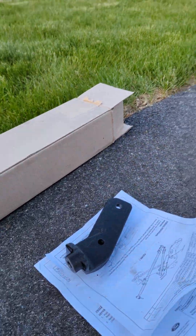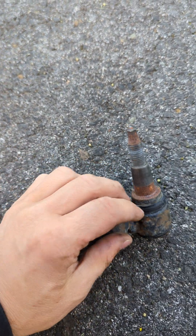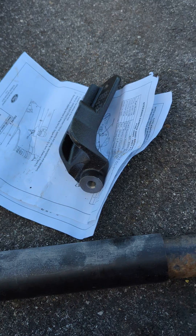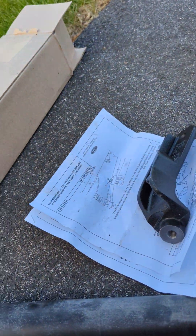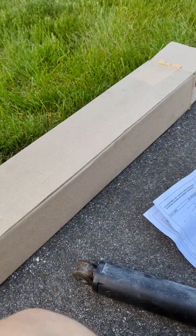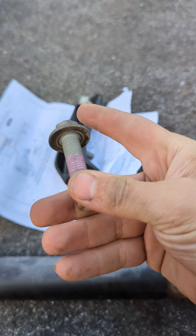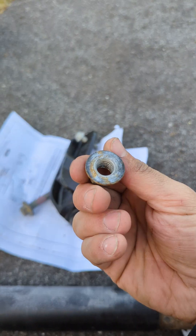It's easy, not hard. The hardest part was hammering it out. There's a fork you can rent that makes that easier. I didn't change the bracket — you don't need to unless it's broken or you just want peace of mind putting everything new. The kit comes with the damper, two bolts, and a bracket. I did change the bolts with new ones and put some paint on the threads so they hold tight and won't unscrew while driving, and I put a new nut.